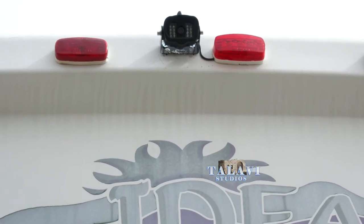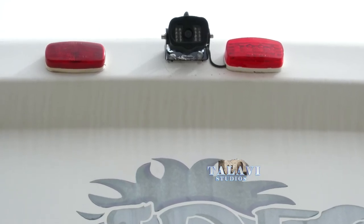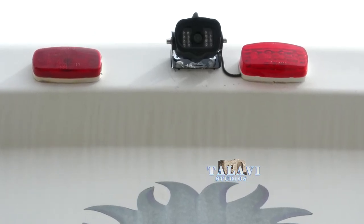If you don't have a wiring diagram like I do for your fifth wheel, you may want to get a DVM and check the polarity of the leads coming out for your marker lights, if that's where you tie in.